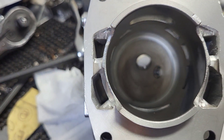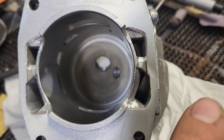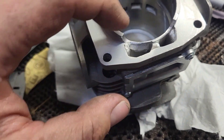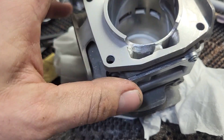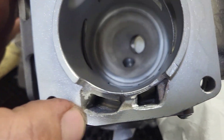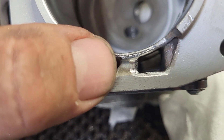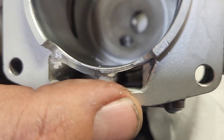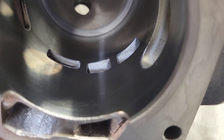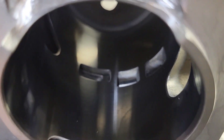I didn't make the holes much bigger. You can see I just tapered everything in on my secondary. Now I'm done with the lower work. Relieve these skirts to where you have full flow to the transfers. Took the step out of that back wall, so hopefully it'll flow better. Tapered everything in. Leaving this little bridge here — I just tapered it in toward the secondary, left it flat over here. This one little hole feeds both of those ports. You've got more port area and at a steeper angle than you do with your primary.